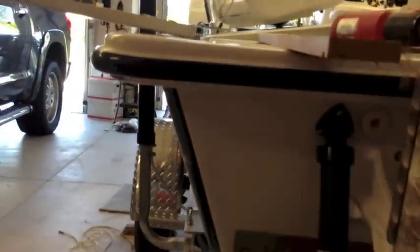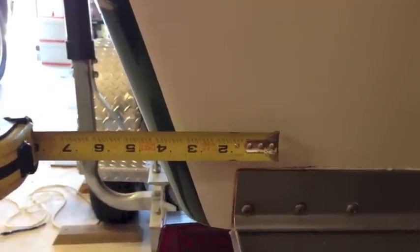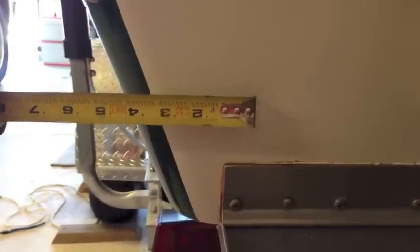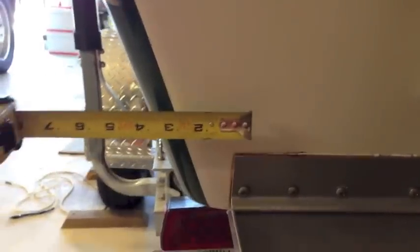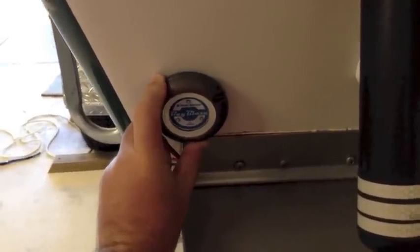The other compensation we need to make is side to side. You can see the edge of the hull on the side here — there's some thickness there and we can gauge that by how thick the wall appears to be when you measure the top of the deck compared to the edge of the hull. So if we mount this light somewhere between 3 and 4 inches in, and high enough so that the light does not hit the trim tab bracket, we should be good. I'm going to do some final measurements and try to get this as far down and out as possible to make the light pattern the best it can be.